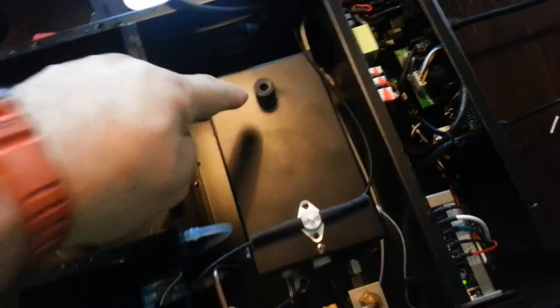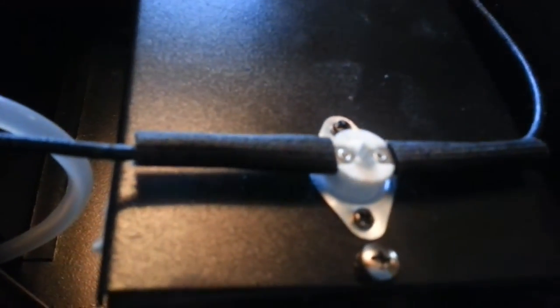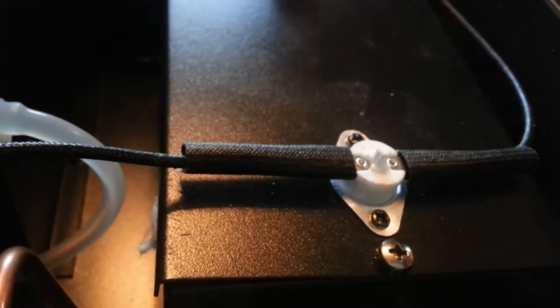They told me to unscrew the top and take it off. Pretty cool — there's the LED light mounted right there, and the fog comes out of here. This little thing right here is like a breaker, and if you press the end of it, it resets it. That's what happened — it had tripped that breaker. I just reset it a few minutes ago, and now when you plug it in and press the remote, it blows smoke.